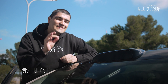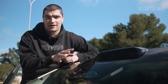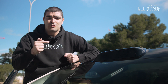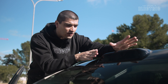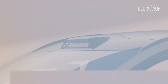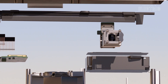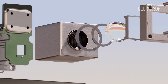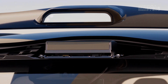This is a LiDAR unit, and it's the first time on the channel we're seeing a production-ready vehicle with such a device embedded into the car — something that's become commonplace in China but where Europe catches up a bit later. A LiDAR unit is essentially a laser scanning device: it shoots lasers out in front of the car, times the reflections, and builds the geometry of the world around it. The vehicle uses that for self-driving but also for critical safety operations. Volvo have partnered with a company called Luminar for this device.